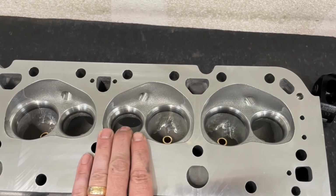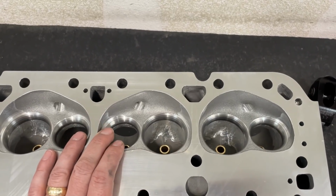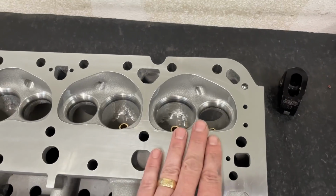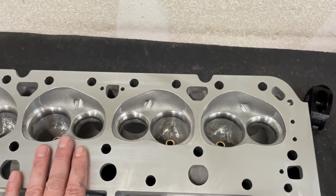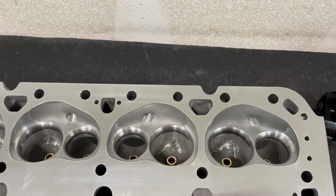Now, all of a sudden, your engine blows up because the piston hits the valve, and it breaks off and destroys your engine. And you're like, well, I checked the piston and valve clearance. Most people only check it on one cylinder, by the way. You're like, I checked it, it had enough clearance, everything should have been fine. It was probably the valves, some cheap valves, and that's why they failed. When all along, it wasn't.